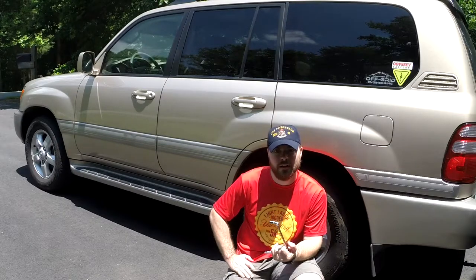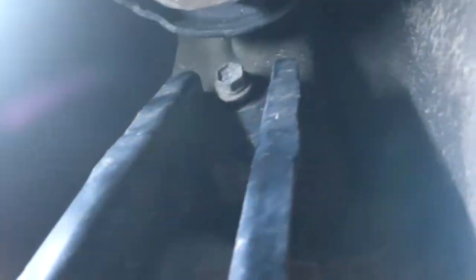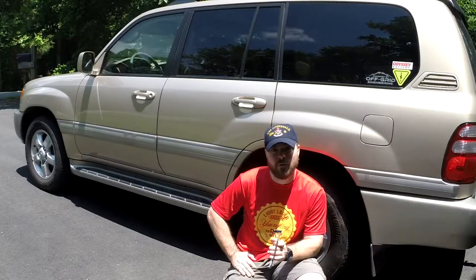I got some of that info off of I Hate Mud. You can see right up in here — this is the rear bracket and you have this body mount right here. I've already partially backed this out, but just to show you: when I get the socket in there it just barely wants to go, and it's even tight for that universal joint to get around there. But you can do it — that's why you've got to use the smallest one, the quarter inch.